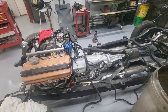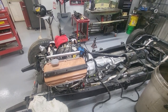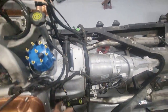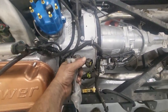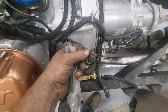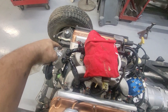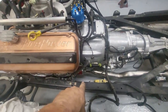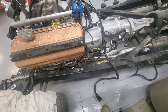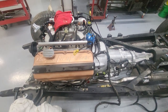Probably run the spark plug wires around the corner here. The only connector I have at this point is for the AC high limit switch — which is in the ECU for idle-up purposes — and the crank position sensor which will route down. I'll still need to run a wire from the alternator to the starter for the charging system, for battery positive. It's going well.